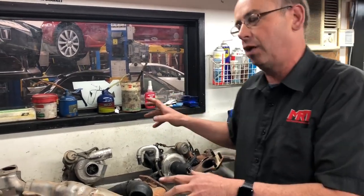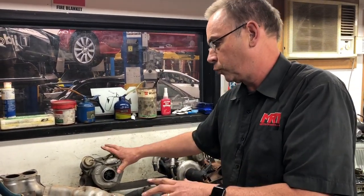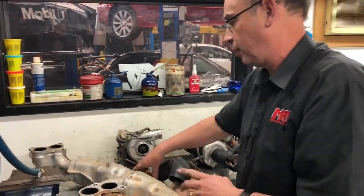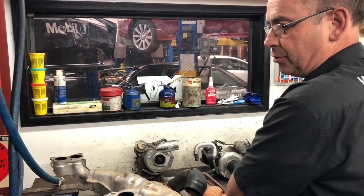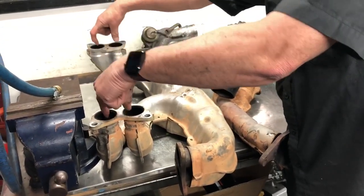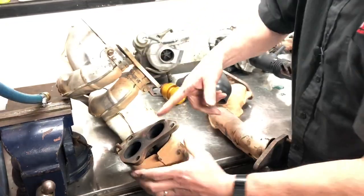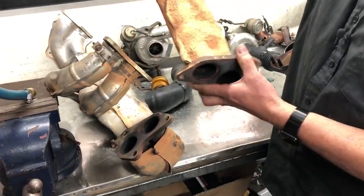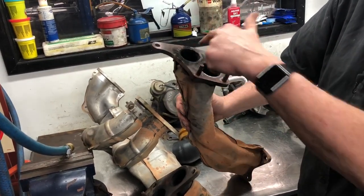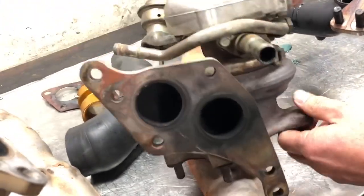The intake side underneath the inlet manifold and behind the power steering pump on most Subarus has a plastic intake pipe — solid and hard to resist vacuum — with the squishy end bolted up with a hose clamp on the front of the turbo. That's a single scroll turbo setup. When it comes to the twin scroll setup on Subarus, the only twin scroll production road car sold was the Liberty 2003 to 2004 2-litre, which had an early model twin scroll with a different exhaust manifold. On the twin scroll rally car setup, the exhaust energy goes down through the outlets and around the sump, collecting into two pipes which come around into the up pipe — maintaining two pipes all the way up into the underside of the turbo.